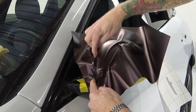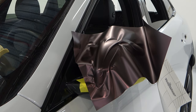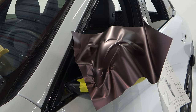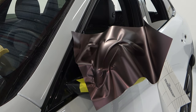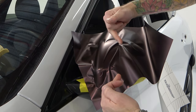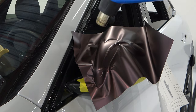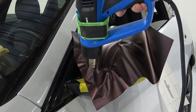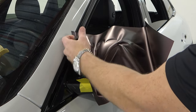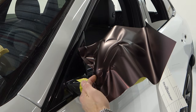The goal here is to have tension leading across edges and not away from edges. We're going to find out when we go to stretch the main piece. Watch what happens when I shrink the inside — all of my tension pulls right along that very edge. Let's heat it and you should see this shrink down on the inside of the mirror. That's exactly what we want. Then we're going to smash down the rest of the film on the other side because we're cutting it off anyway.